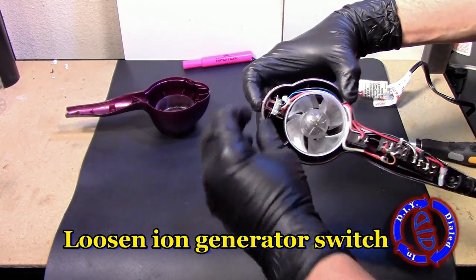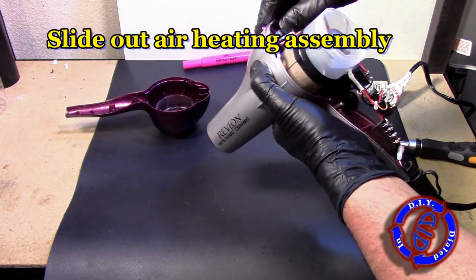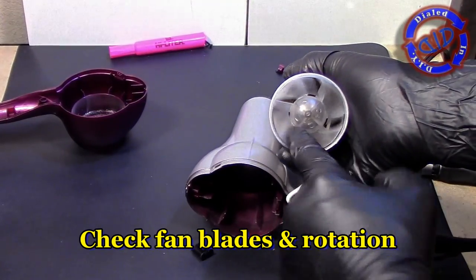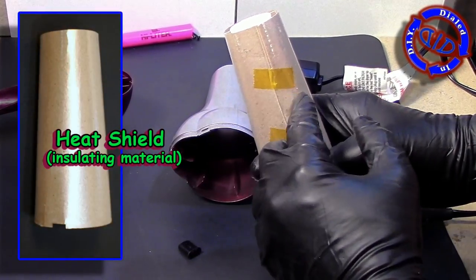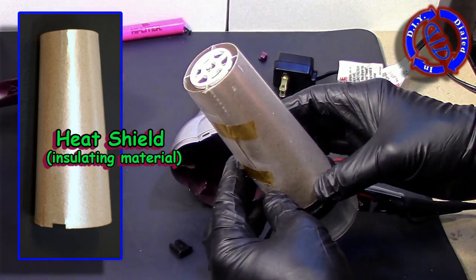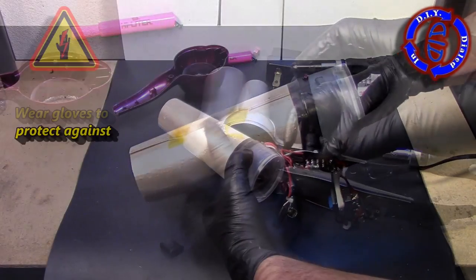I really take my time to make sure I have all wires and switches freed up as much as possible so that as I slide out the heating assembly I can do it without causing any damage to any of the other parts. The heat shield around the heating element may seem like a flimsy piece of paper or cardboard, but it actually serves quite an impressive purpose — it helps to minimize the amount of heat that's transferred to the hairdryer body.